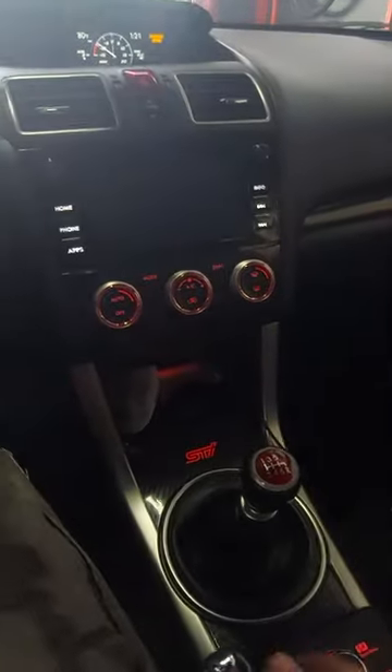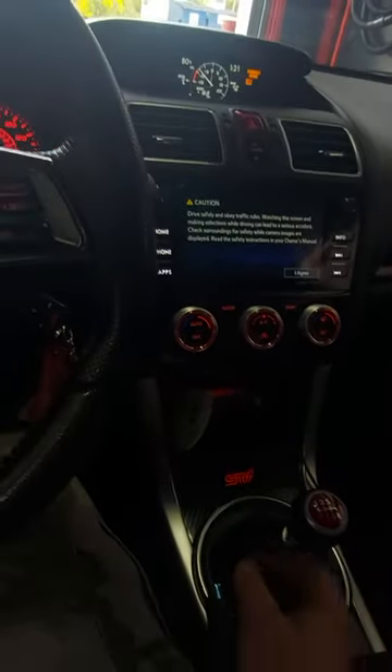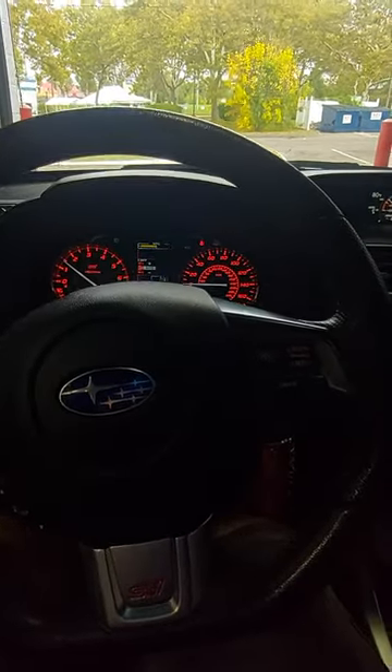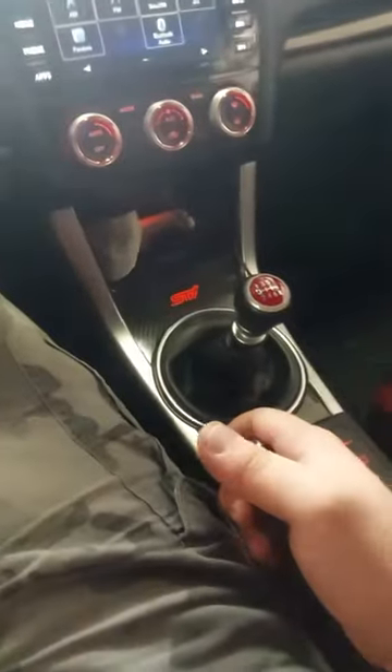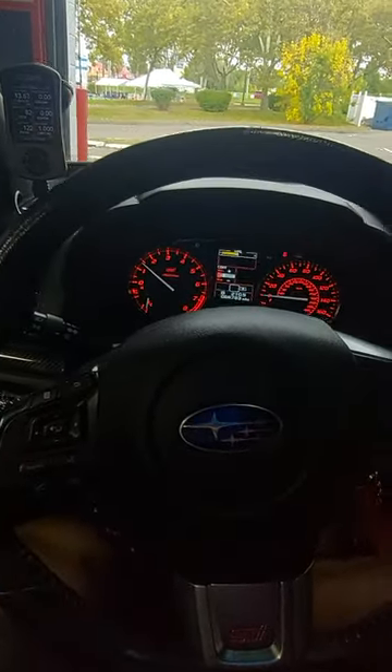The car starts normally. You do what you gotta do — go driving around, e-brake down, drive around as normal. It's when you stop that it's called reservation mode. Car is in neutral, you've come to a complete stop, you pull up the e-brake, you let off the brake. You may hear the remote starter brain click.